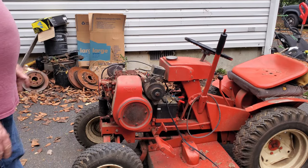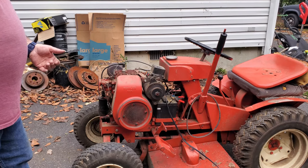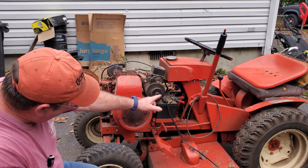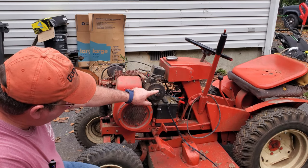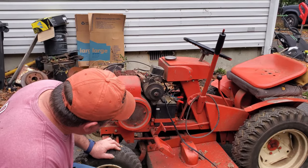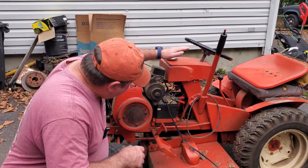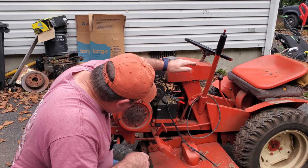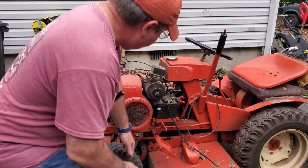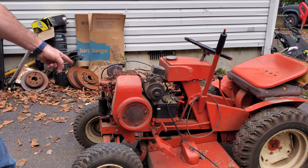At least we found out that it runs. The next thing would be to get fuel up to the carburetor, which means it has to go through there, and that bowl is gummed up on the bottom. It may be gummed up at the inlet where the valve is — that stuff in there is liquid now — but we're getting a little bit of drip now. The fuel just isn't going into the bowl, so the next step would be to get the fuel up to the pump.